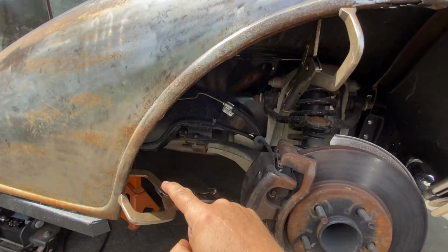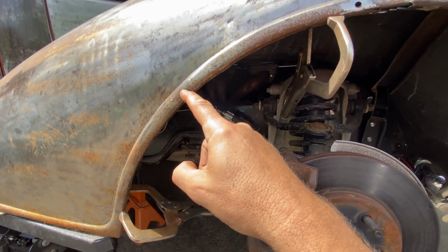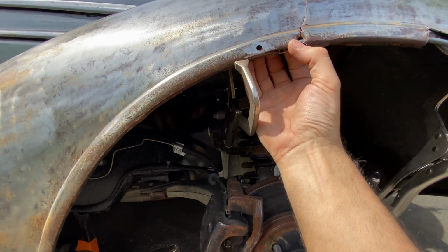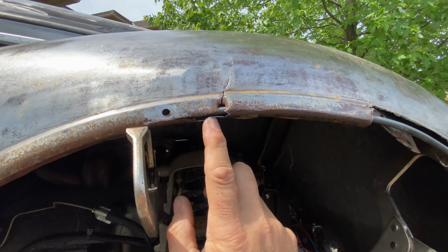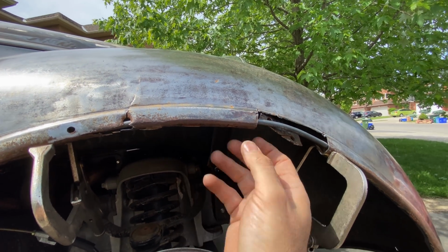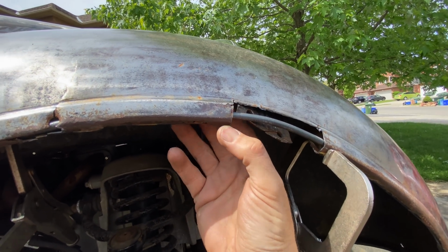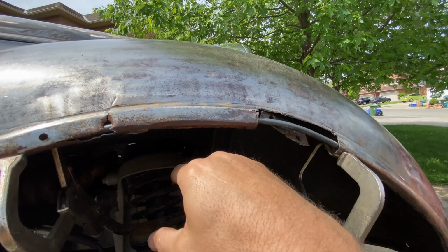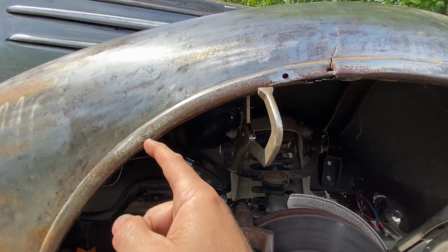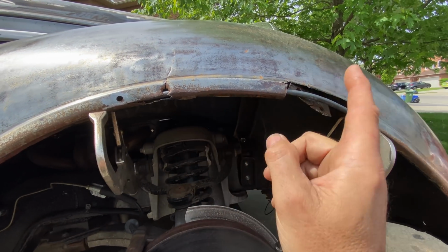I'm going to start with welding this rod all the way around to here. Keep on going, move the clamps, get it nice and close to the edge. That obviously needs filled in there. And when I get to this point, this rod should be right down. This needs bent in and up a little bit. So there's no point doing that until I've got it all nice and neat all the way around here. And then I'll tackle that.